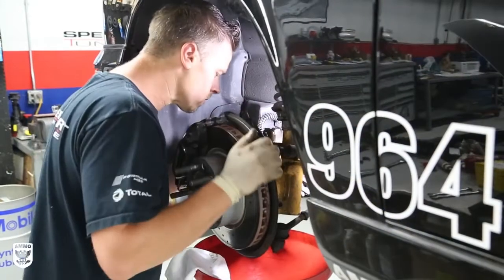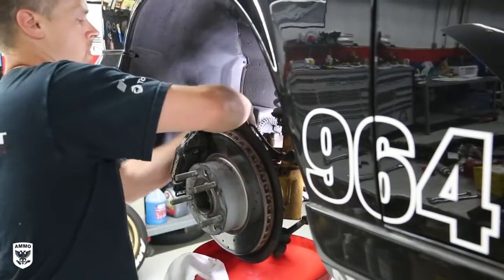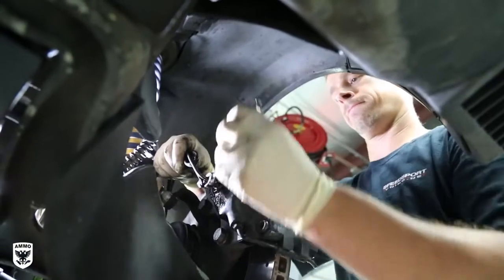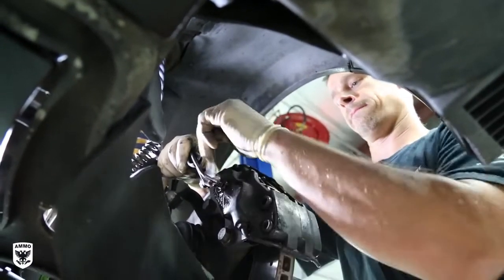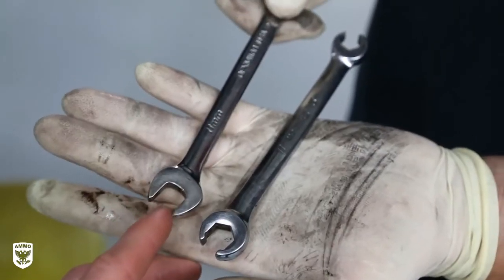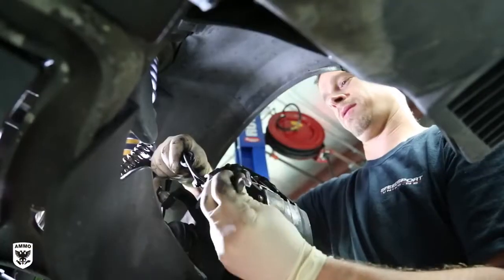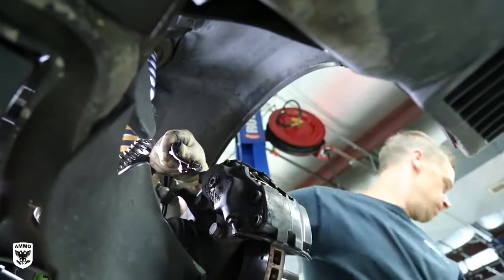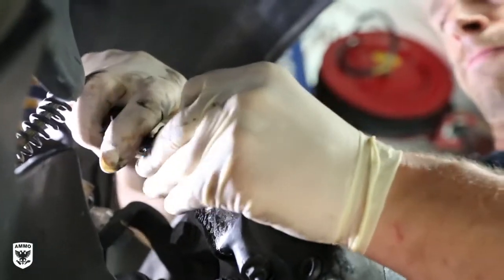After removing all four wheels, Brian quickly disassembles the stock system by first removing the brake line and capping it. Notice he is using a specific 11mm brake line wrench, which makes it much easier to remove the tight flare nuts on brakes, fuel, and other lines. This will easily slip over the lines and prevent the rounding off of the nut. I later removed the brake line cap to film the Super Blue dripping, and I forgot to put it back, so Brian made me clean the floor.